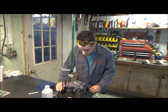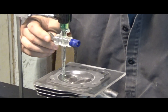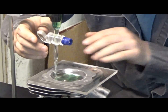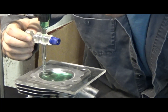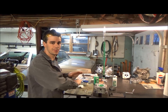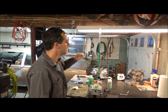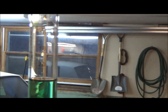We're going to get into it here and see what we come up with. You kind of have to focus more on where the fluid is going than where it's coming from. You don't want to spill any on top of the plate — anything that doesn't go in the hole and ends up somewhere else is going to mess up the measurement. Definitely a tedious process. We had to pause because you have to have it perfectly balanced; when you fill it up, air bubbles form and you have to maneuver things to get the air bubble to where you're filling from. I got a good reading: going top of the meniscus to top of the meniscus, it's right at 21 and a half cc's.